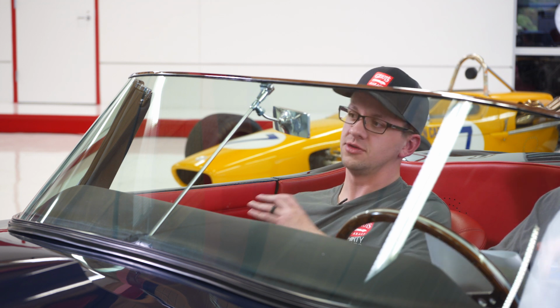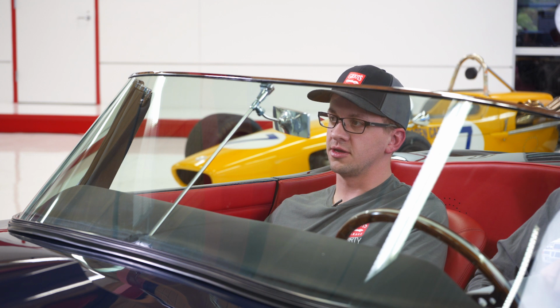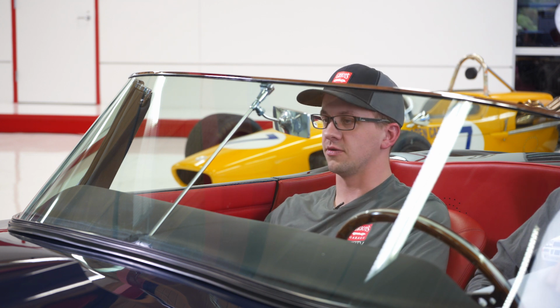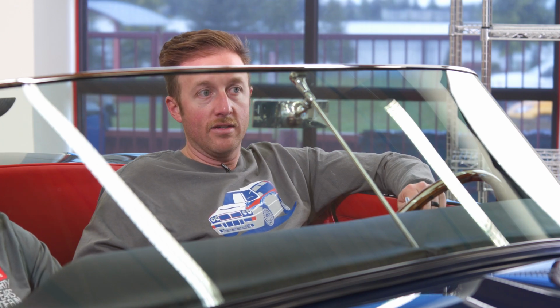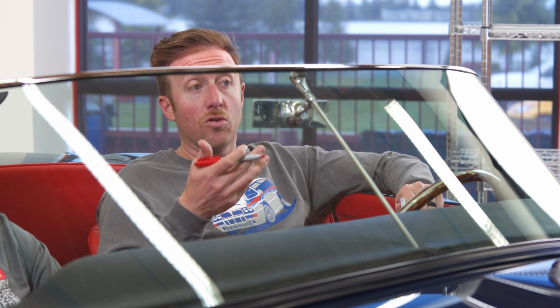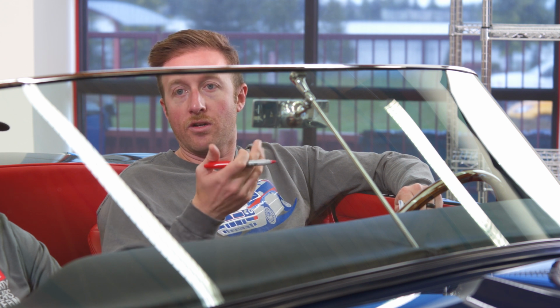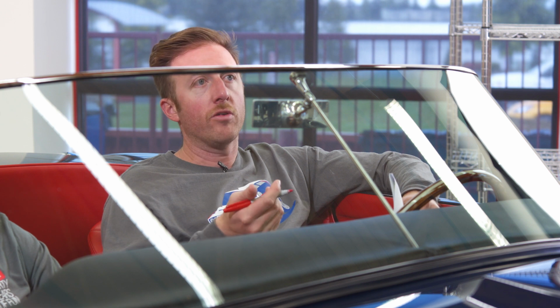Of course, make sure that you've already washed the car, and then either re-dilute a clean bucket of Brilliant Finish car wash or foam it onto the clean car and then clay over the top of that. You won't need a lot of solution, so you could probably just do a gallon and 1 ounce of Brilliant Finish, and that's enough, if the car's still wet, to lubricate the clay mitt. And because of the foam and just the materials, you'll bring some of that with you and just keep going back to the bucket. But the clean water is critical.